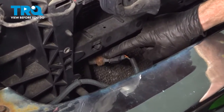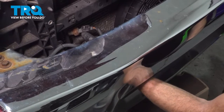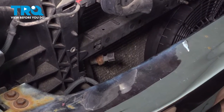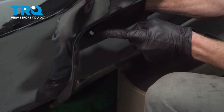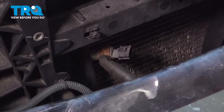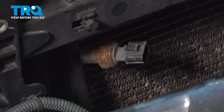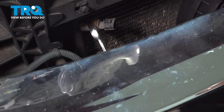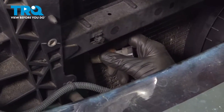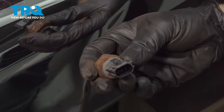This is the area you're going to have to access. To gain access, carefully come right in through the area underneath the front bumper. Grab onto the wiring harness, squeeze the locking tab, and take it off. Pull it out for a close look — as you can see, there's no corrosion, so set it aside. Now use a 24mm wrench to come along this area and turn counterclockwise to remove the pressure sensor. Take that off, give it a quick inspection — we will be reusing this — and set it aside.